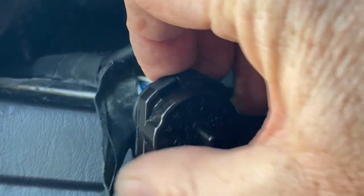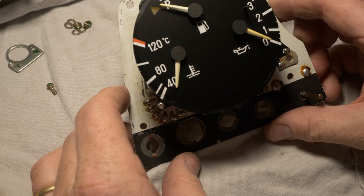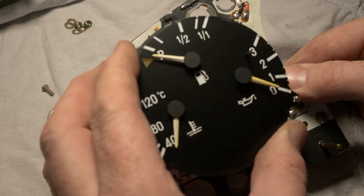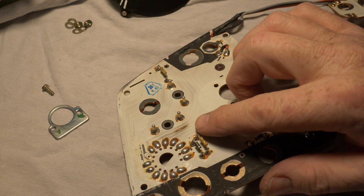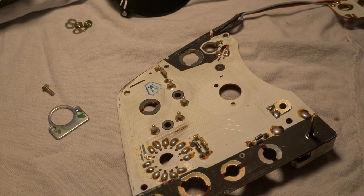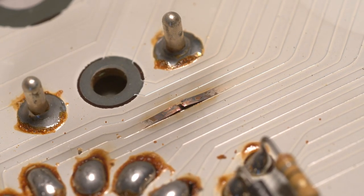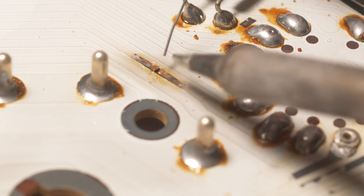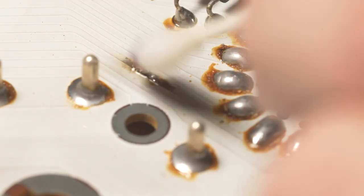But I wasn't convinced that was the only problem. I was still pretty sure there was something going on inside the cluster. So I pulled it open and this time took the actual gauges right off of the board — which I didn't realize until recently that you could do. Sure enough, underneath there was a burnt trace, which is the ground circuit, burnt up almost perfectly like a fuse. It was hidden behind the gauges. I tried soldering this, but it wasn't working at all — it's just very fragile material — so I wasn't able to do that.